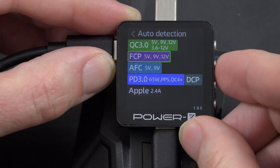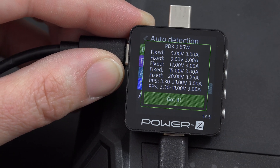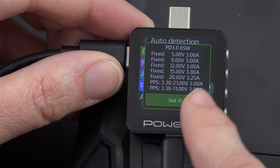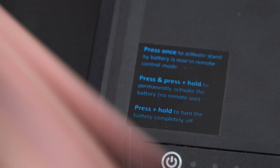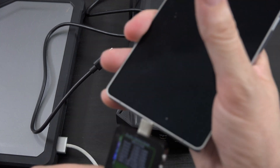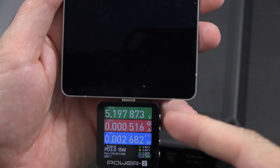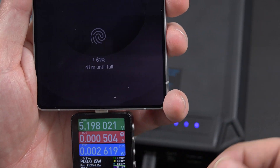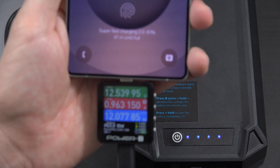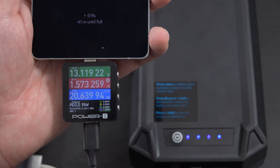The remote's pretty cool. We've got FCP, AFC, PD3, and PPS. What does that mean? That means when you plug it into your Samsung phone you're going to see super fast charging. If you have an older Samsung you'll only get super fast charging 1.0, which is up to 25 watts. If you've got a newer Samsung, they actually changed it where you don't need 5 amps of PPS — you can use more voltage. If you've got a newer Samsung you can definitely charge at super fast charging 2.0, which is up to 45 watts. My battery is at 61% so it's not going to charge at its full 40-watt speed, but this thing could definitely do it.